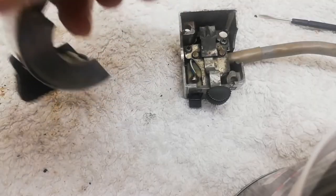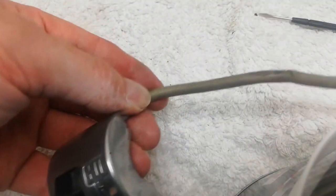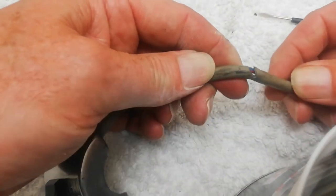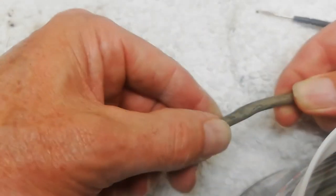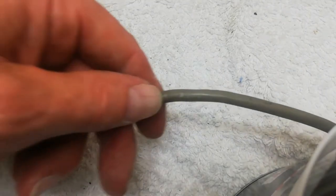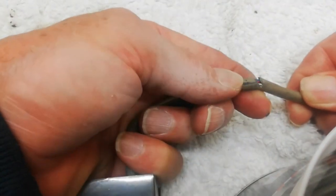Okay. Also, we were talking about shorts the other day. This is a typical handlebar switch wire, and I can guarantee that virtually all bikes of an age are like this. Look, there's nicks and cuts down here. Various parts of the wire where previous owners over the years have clamped it wrongly, they've crushed it, that's crushed there, it's been caught in a headlamp, been caught in the clips that hold it onto the handlebars, etc. So if you get a short circuit, this is always one place to start. I mean, I've checked these, like that's a bad cut, but it is only in the outer sheathing.